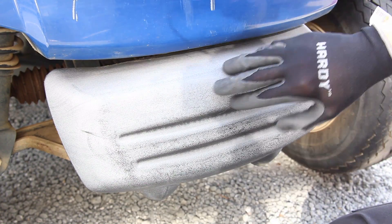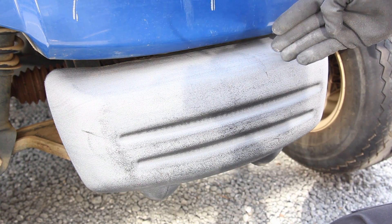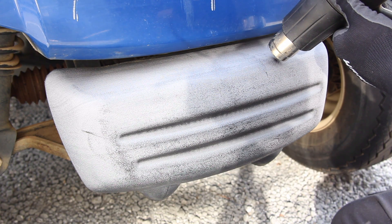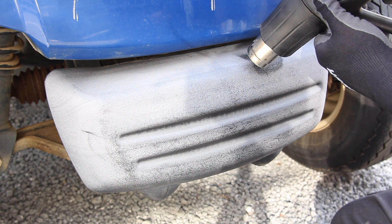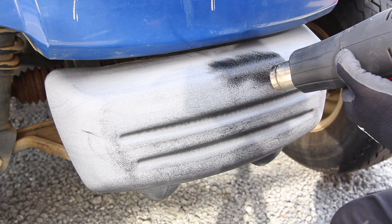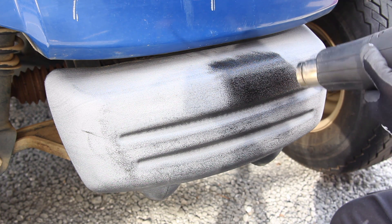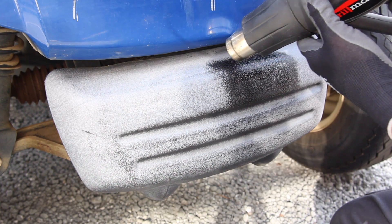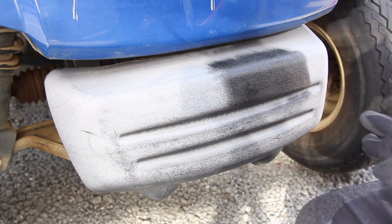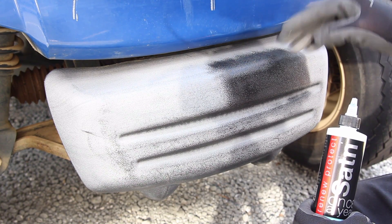In this case, we are going to use the heat gun technique, which is a last resort, and you have to be very careful with it. The key is to keep a consistent distance from the surface and consistent movement. Once you've got the right distance and the right level of heat, you can see it's pulling the elements up through the plastic and restoring the surface. Be very careful around your paint — you may want to use some type of device to border and protect your paint, especially on a car with clear coat. Now we've got that restored with the heat gun. You would very much want to avoid using the heat gun again, as this actually weakens the plastic.